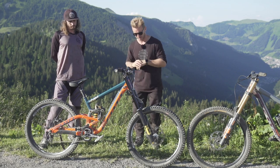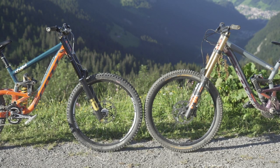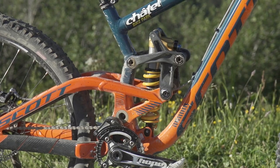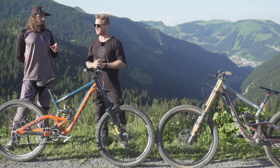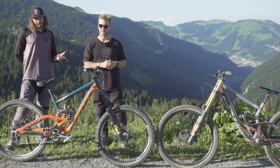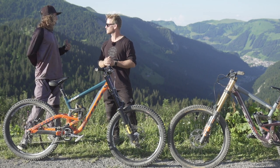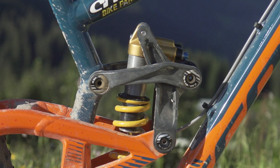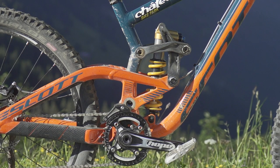This next question — I kind of saw it straight away, because they're both 2018 bikes but they're totally different, and it's this linkage. This linkage is totally different to that one — this is the previous linkage. Yeah, I'm still running the old linkage. The bike's designed more and more for racing, so if I were racing I would probably run that linkage. But I've got a very specific riding style, and this linkage suits my type of riding more. I like hitting big jumps, overshooting bike park tables, landing flat. It gives me the opportunity to run a lower spring rate, but it feels stiffer. That's quite a big shock in there — it's a 260. And that one's a 240.